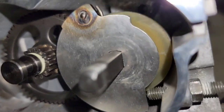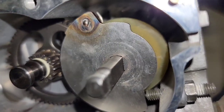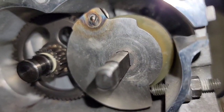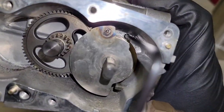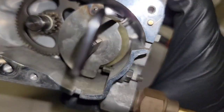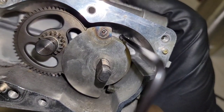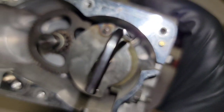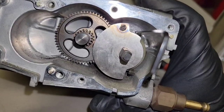I didn't do this the first time. The instructions that I had weren't very clear, and it unwound, and it took me a little bit using the picks to try to spin the spring around. So here you can see I shoved an Allen wrench, that's actually the perfect size, into that hole that was there, a little dimple, and then I have the internal spring trapped behind it. So now this third gear plate will come right out, and I'm going to put the stock components back in.